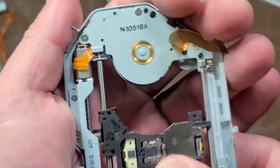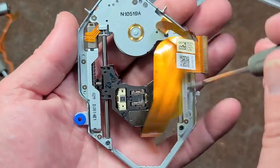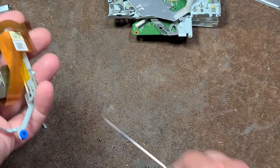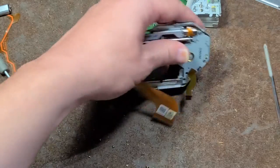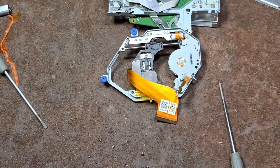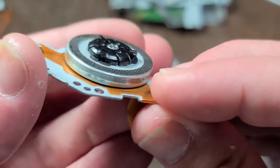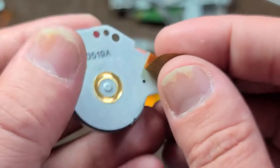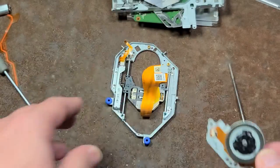This is an actual four-wire motor, so I believe that's a stepper motor. And then this is just going to be a DC brushless motor, just like in a computer fan. Let's pull out the drive motor — these screws may be a little tighter, and they are, just because it is the drive motor. The head of that screw is so super thin — ten-thousandths of an inch thick. And that's all this is — just a brushless DC motor. It's a four-wire as well — there are eight wires here. Four are going to this motor, and then another four passing through to the head motor itself — that's the reason this connector had so many contacts.